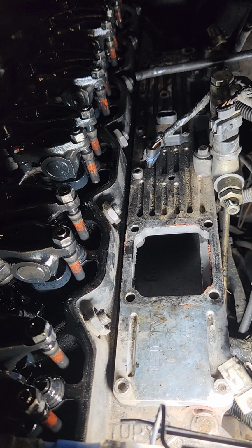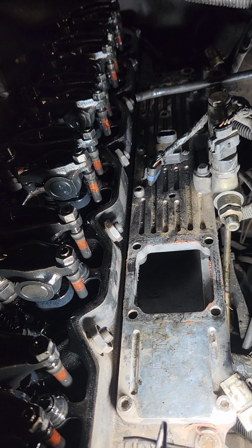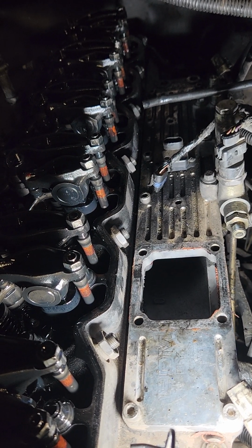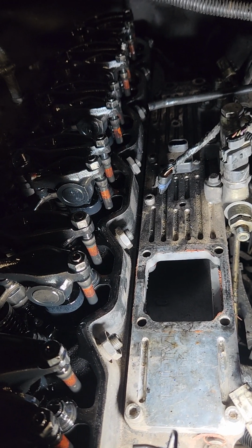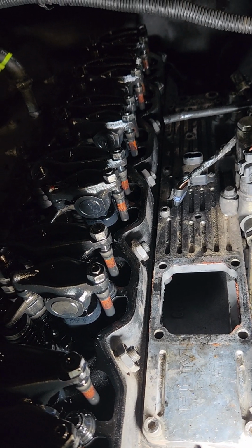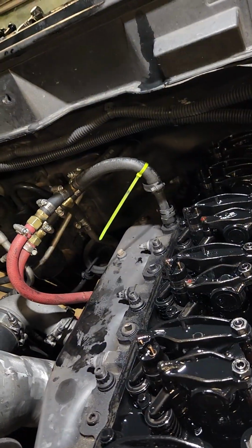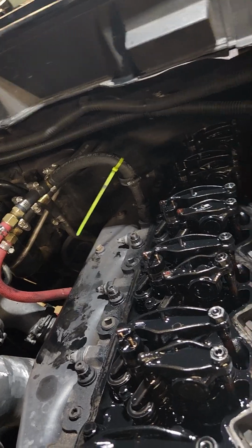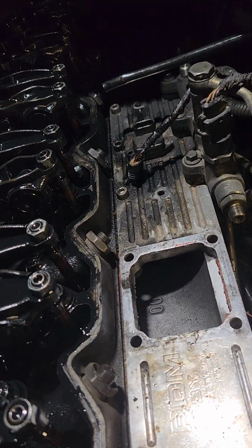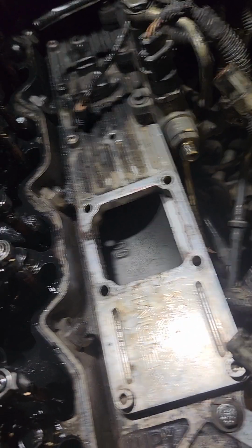Those tube nuts right there are what you're going to need the foot-pounds of torque on, so keep that in mind. It's a good idea to go ahead and whip that baby out, get it ready. I would say at this point we're pretty close to halfway there. You might say, well, we haven't even pulled the injectors yet. Yeah, but that's not really that bad. Technically, I guess the halfway point would be when we actually pull the injectors, but I say we're about halfway as we are. So hold tight. I'm going to get the size on those injector tube nuts, and I'll get back with you.